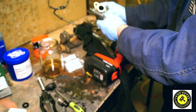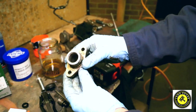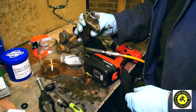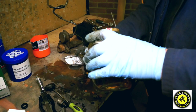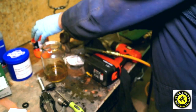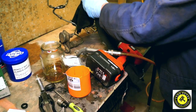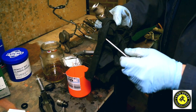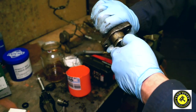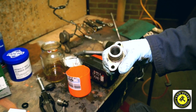Clean this out with air, away from the camera and eyes. Basically I'm feeling to see how smooth it is inside the bore — it actually looks pretty good. This doesn't always work replacing seals, because if you have a lip inside the bore, the seal won't hold properly. Honing doesn't remove metal — it just roughs up the surface and makes it decent enough for the seal to work. Use brake cleaner to clean out; don't use spirits or white cleaner. If you don't have air, use a clean lint-free rag. The bore is actually quite nice — there's a dark area where the corrosion was, but it should be good to go.